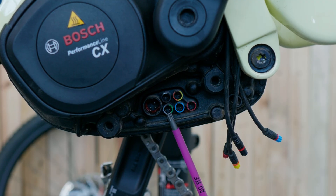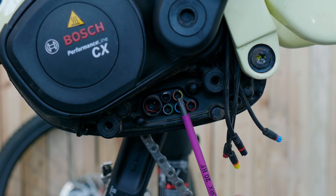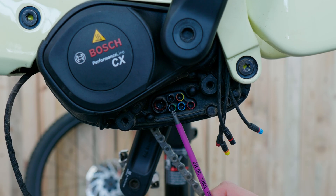The green LPP plug can also be connected to the yellow High Power Port. The LPP — the Low Power Port — is marked in green and is also responsible for powering additional external devices, also using 12 volts. However, it cannot reach peak currents of more than 1 ampere, and some bikes may already have a gray cable connected from the LPP to the speed sensor, in which case you won't be able to use the Low Power Port.